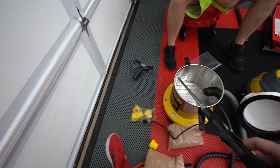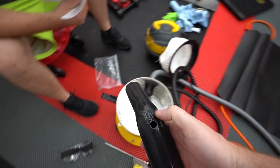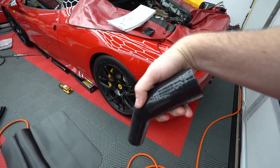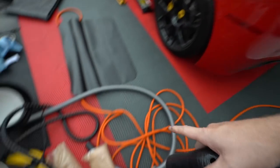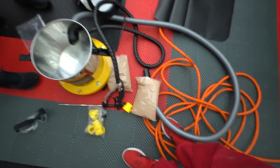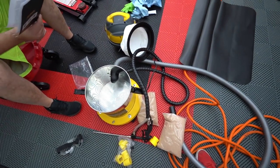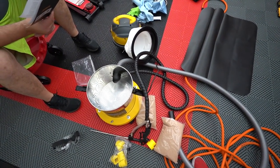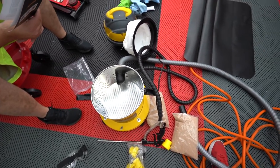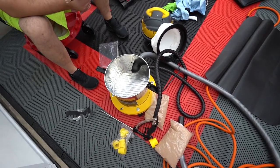The wand routes through this hose hole, and then we take this end, attach one of these fittings, and plug it into the intake port. We stick that little nozzle down by the valve and blast a bunch of this crushed walnut media in there. It acts kind of like sandblasting but it's less abrasive than sand — we don't want to score the intake valves, just knock the carbon off. Then we suck it back out.